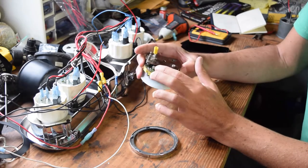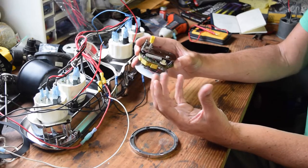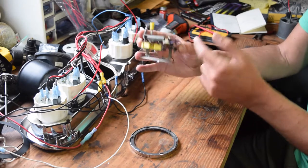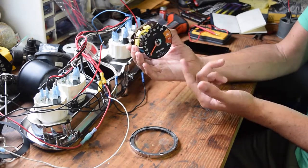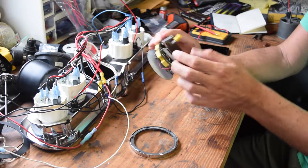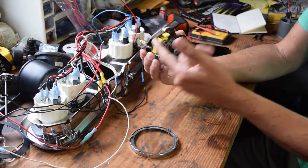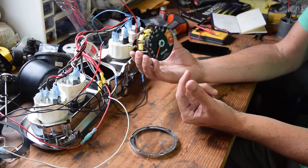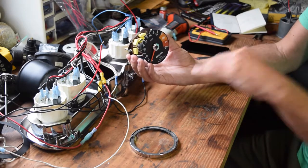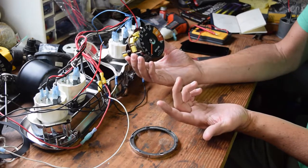So basically what happens is you bridge this potentiometer in here and it has an adjustment screw, so you can actually adjust the resistance coming into the tachometer, and that in turn changes the output, right? We kind of had it centered when I started up the car, as you probably saw in the video. It was a couple hundred RPM off, so I used a small screwdriver and tuned it using that potentiometer, varying the resistance, and got it to match my Craftsman timing gun. So now the RPMs match the digital gun. I know that's accurate because it's brand new, and this thing is good to go.